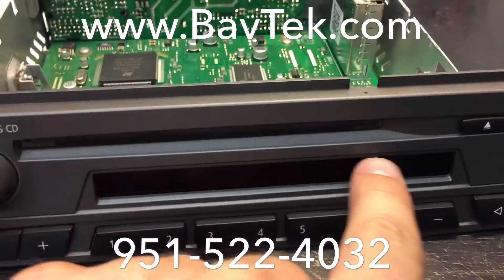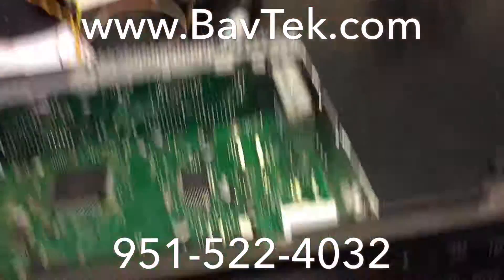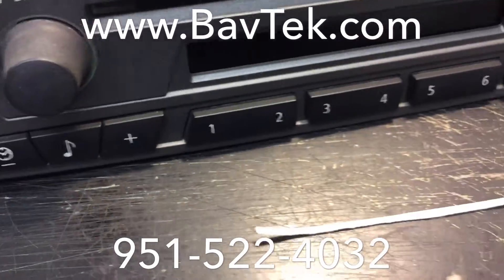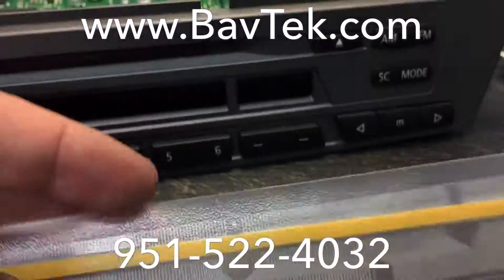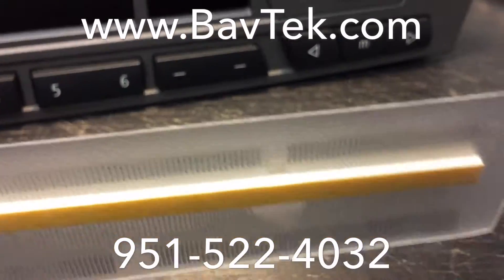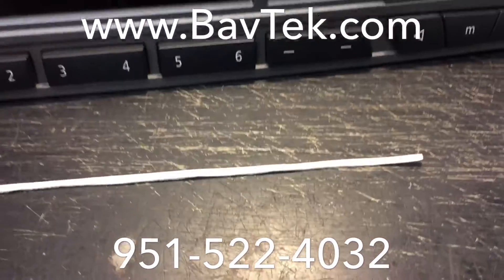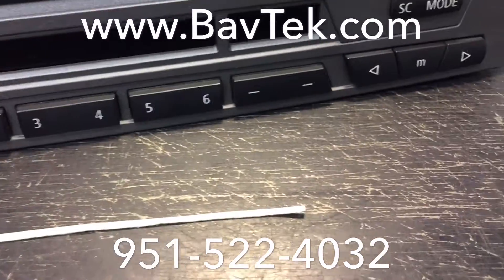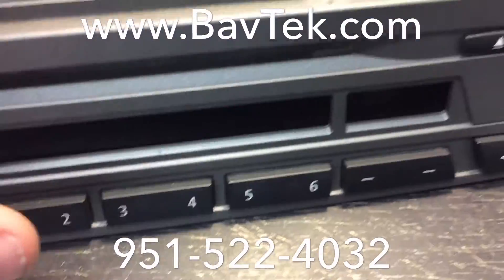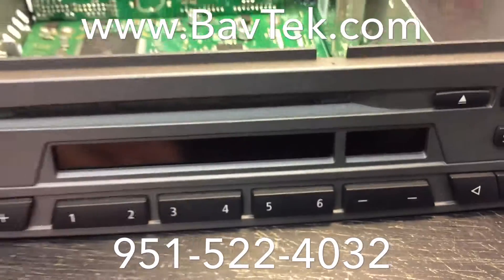On that bracket that was right here, what I did was I twisted all the tabs on the back and removed the bracket. I stuck a little strip — this itty bitty little strip — it was from a different kit and I split that piece into four. I ran one of these little strips along the inside of the bracket at the bottom, because that's where the contacts are. Then I closed it and carefully pressed it while twisting the tabs without cracking it.